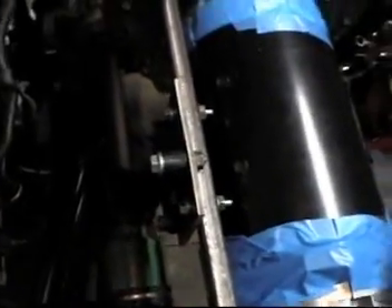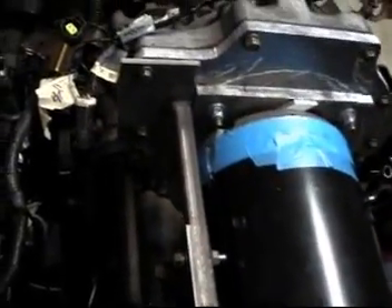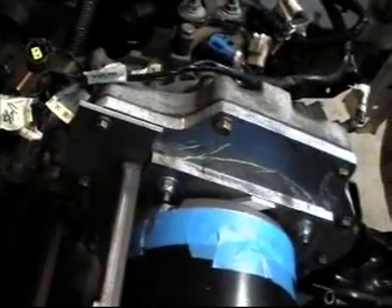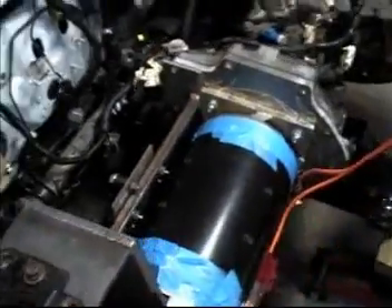There's a little arm on this side which bolts to the support for the passenger drive shaft. That's welded on this end and bolted into the same holes of the adapter plate. I just need to prime it, paint it, make sure it doesn't rust — otherwise it works pretty good.